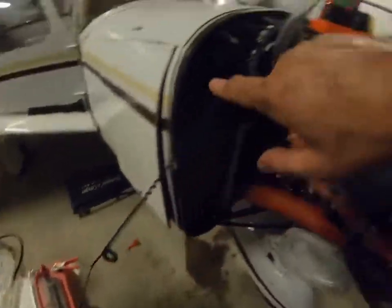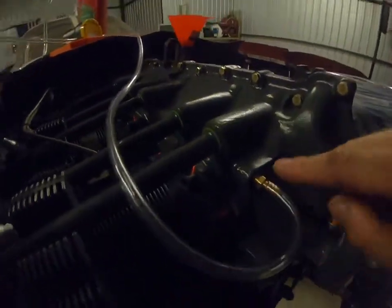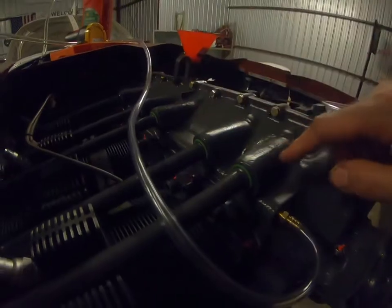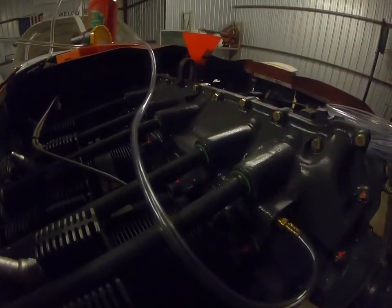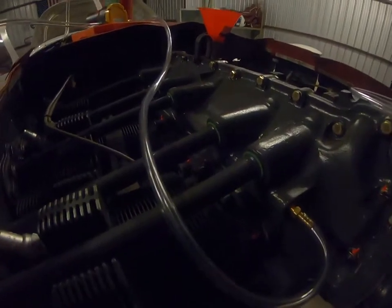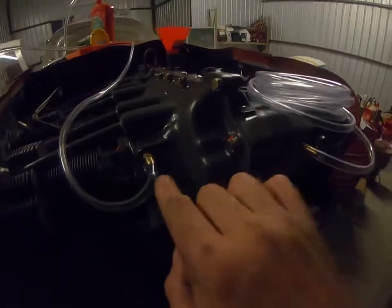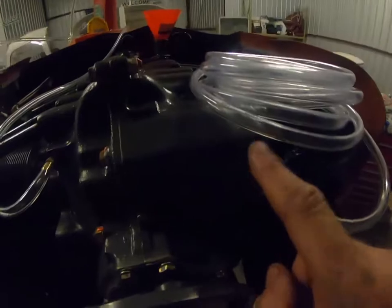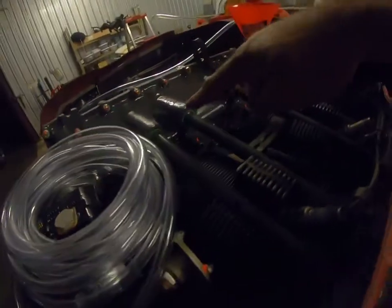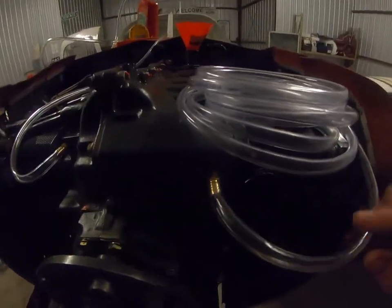A 12-volt battery oil pump plumbed to the galley will pressure-feed oil in through the galley, which will lubricate this part of the valve train and squirt oil into the engine that drains down into the sump. We're just going to backfill the sump using the oil galleys for a couple quarts. When we're pumping in here, eventually we'll get a little out of this coil here — this side feeds this galley — so we'll oil that too. We'll pump here until we get oil coming out of this side.